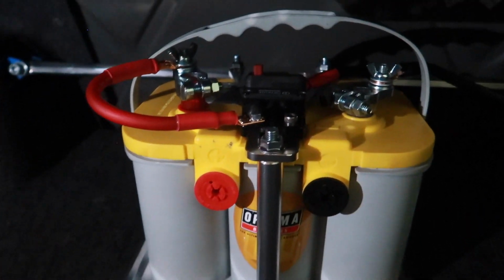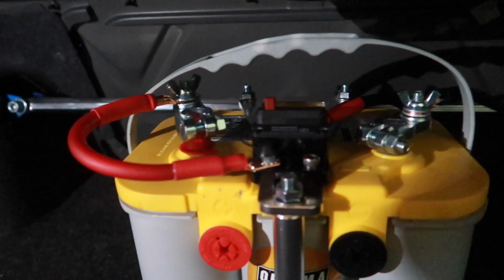And then I just got done mounting up the rear strut bar, making sure everything's nice and clean and routed. Got the power wire made and installed. Very professional, if I do say so myself again. Nothing obstructs. Went ahead and grounded the battery to the rear strut here. I went ahead and scored it with a Scotch-Brite on the bottom there, so this should be a good ground.